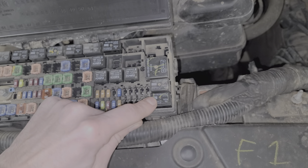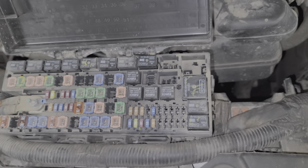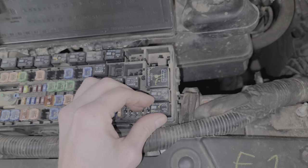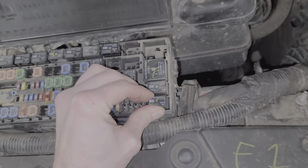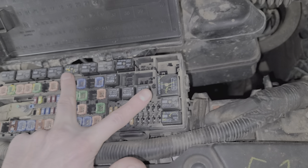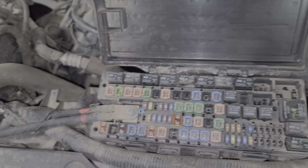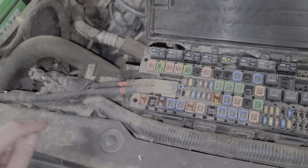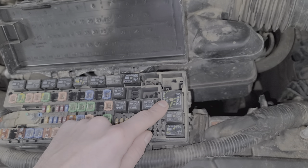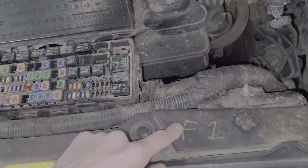We've got our cooling fan low speed relay. There's also the cooling fan control relay and the cooling fan high speed relay. All three of these relays are controlled by the powertrain control module. The low speed relay is independently controlled, whereas the high speed and the cooling fan control relay come on together. When these two relays come on together, fuse 15 sends power directly to cooling fan 2, and the ground from cooling fan 2 is sent straight to ground through the cooling fan relay. When that occurs, the low speed relay will only send power to the driver's side fan motor.